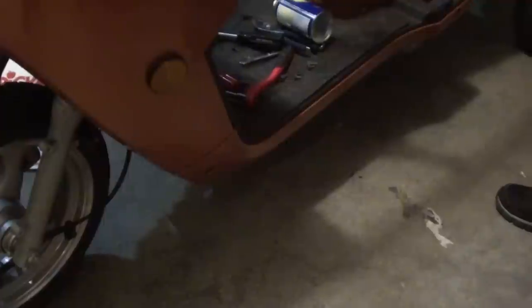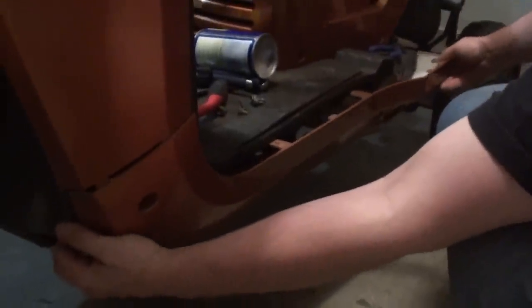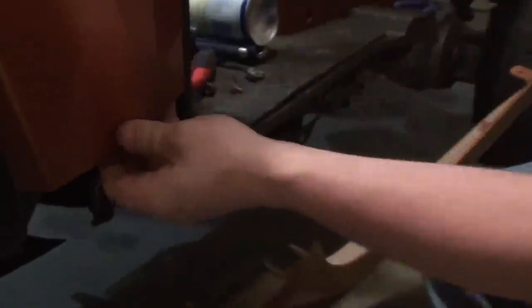I haven't pulled this off yet, but both of these side panels are going to have to come off before the bottom part of the dash. Correction — the two screws: one is here, but one is actually underneath where you can't even see with the camera, but you'll see it when you look under there. When you take the panel off it needs to be pulled forward. You're going to take this and pull it out at an angle, because there are clips that hold here. These are cracked, but if they aren't cracked you need to pull forward like that to remove it.